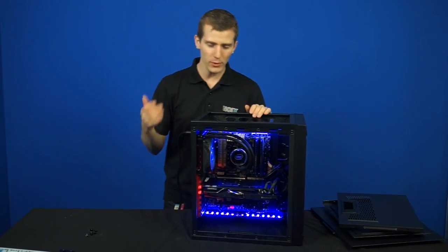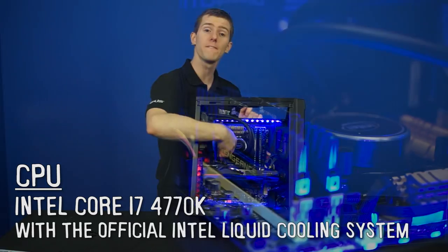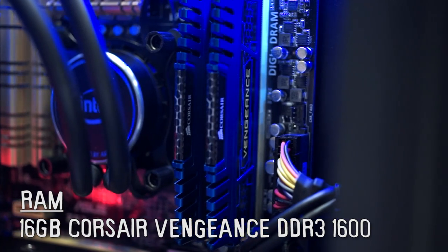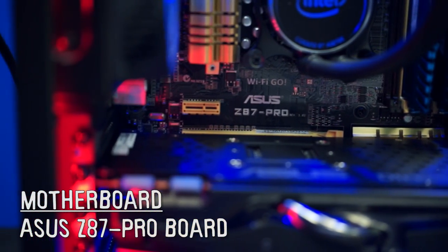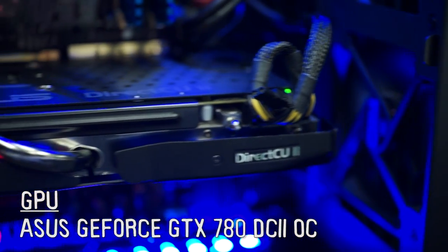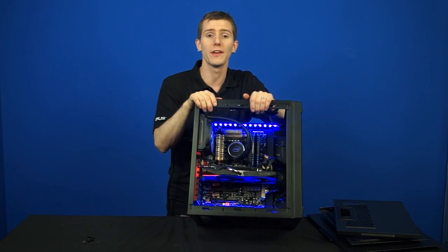Now we have access to the internals. Cooler Master has created a very unique zone structure where all your heat-generating components are separated. The CPU is a liquid-cooled Intel Core i7-4770K with the official Intel liquid cooler on it, using a 120mm fan at the back of the case. There's also 16GB of Corsair Vengeance memory clocked at DDR3-1600, an ASUS Z87 Pro motherboard supporting SLI and CrossFire, and an ASUS GeForce GTX 780 DirectCU II - one of the best graphics card choices on the market, delivering a truly high-end gaming experience with a GK110 core without quite the premium of the Ti version.